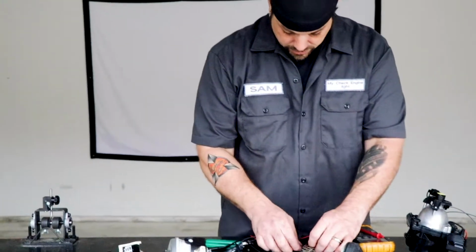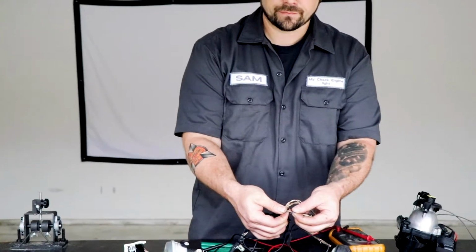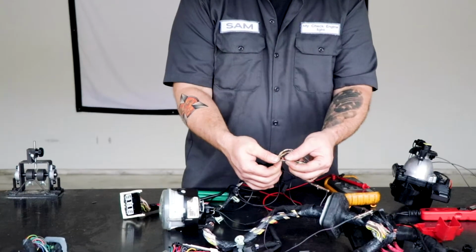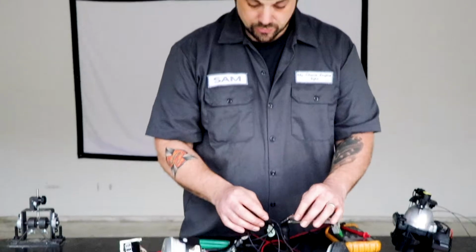We also have this circuit just barely held together. So that's one of the things that I wanted to look at. I actually skinned this down to a single piece of copper because that's what we've always been told, right? Is that if you have a single strand of copper, your Fluke meter isn't gonna pick that up. You can still get the same 0.4 or 0.5 ohms with a single strand of copper, provided that there's no corrosion. But will your load device work? No, is what they tell us.